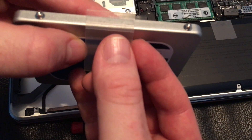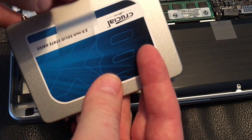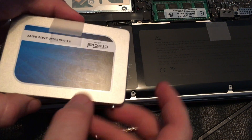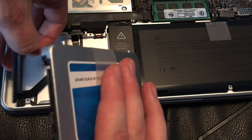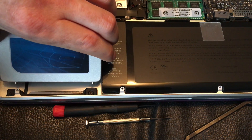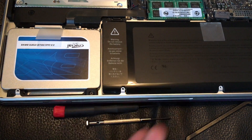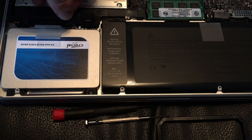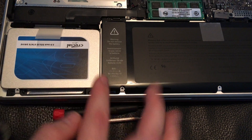Place the pull tab right here in the middle area — it should technically stick a little. Don't worry too much if it doesn't. The way the drive goes in is this way; it's pretty logical and you can't really put it another way because the connectors won't line up. Hook it up, insert this end first so it kind of locks in, then let go — it's all set.